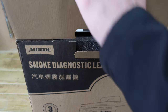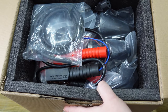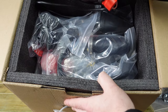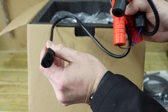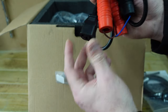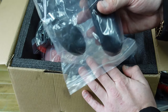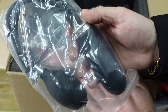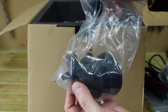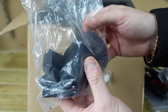When we open up the box, you'll see a lot of equipment inside. You've got all your instructions and an instruction booklet. You'll also see the hose for the smoke itself to come out of, which will plug up. You've also got your power cables. This does use a computer plug socket, but I would advise you not to use any other plug apart from what they give you, because it will overvoltage the whole system. Stick to what they give you, which connects directly to the battery terminals to run the power. You also get a squidgy, which is used to block the intake pipe so you can pump air into the whole system and into the manifold to find where the leak is coming from. You also get all these rubber bungs to block all the tubes and intakes for all different cars, and you can even block off the exhausts with them.